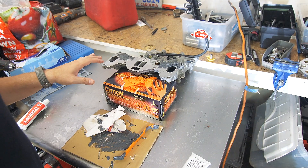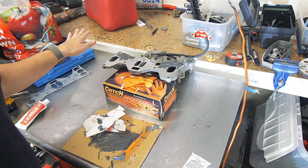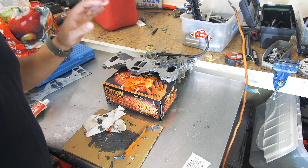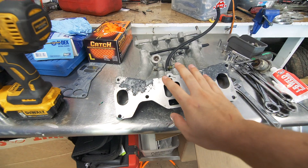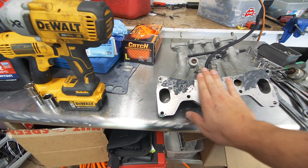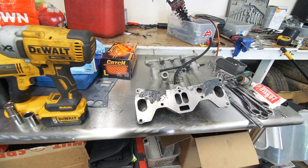This looks good — don't worry about the excess, we're going to take a sanding block to this and make it completely flush. But first we're just going to wait a few days and let this fully cure and harden, and then we'll get back to it. After the JB Weld has had a few days to set, before we proceed with cutting out our ports, what we're going to do is sand this so it's completely flat so that we have a nice surface that will mate to the engine.